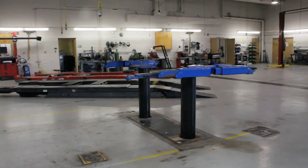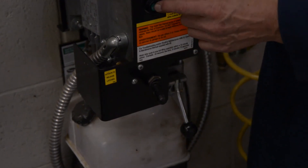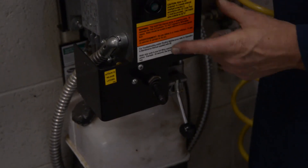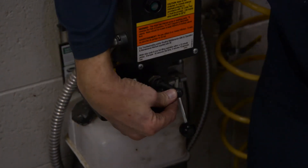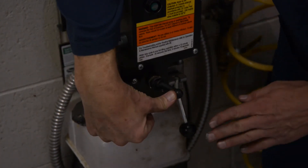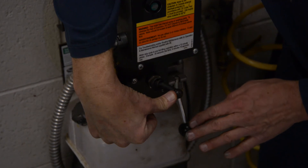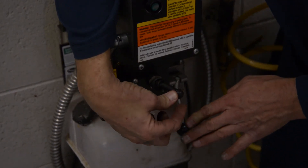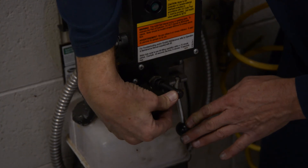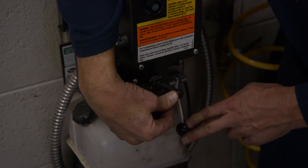When I'm through, we're going to lift the weight off the safety latches. To release them, you throw this little air-operated lever, and then you push the same hydraulic lever to lower. The lift won't move until I push this knob down. You've got to keep this one held over, otherwise the safety latches will spring back in place and prevent you from lowering the vehicle.